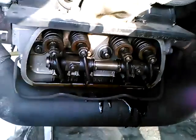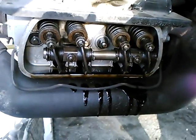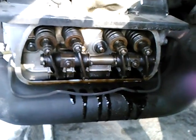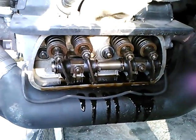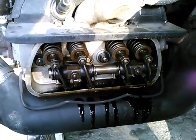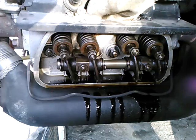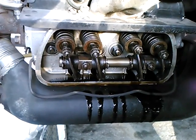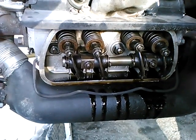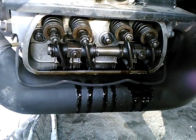Owing to the slant of the street, we're going to have a lot of oil leakage here, which I'm catching in the valve cover. The main point of my exercise today is to illustrate that the action of the valves is all you need to position the crankshaft for adjusting each cylinder's valves. What to look for is a pattern of first the exhaust valve, then the intake valve.